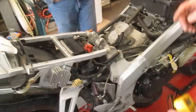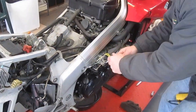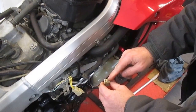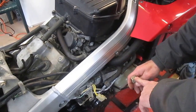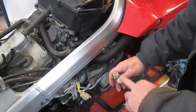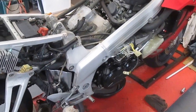The last check you can do is separate the alternator stator from the circuitry. These are the three wires coming directly from the stator. You can run the bike without any circuit connected and check from here — you should get 40, 50, 60 volts out of this, and they should all be hot. Not two out of three or one out of three; if one's out, it's dead. Are we getting anything? We've got zero out of all three. So that's why we know the stator is shot.